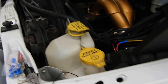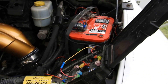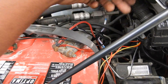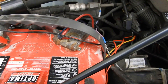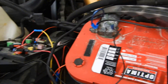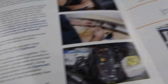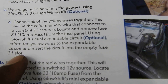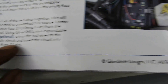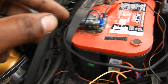Update — everything is wired, though excuse the messy rat's nest. I'm gonna buy some conduit wrap and wrap this stuff up so it looks clean and professional. Running through the fuse assignments from the instructions: yellow wire goes to slot 31, red wire goes to slot 33, orange wire for headlights goes to slot 16.